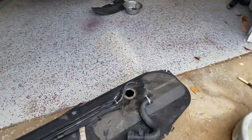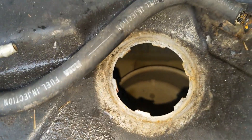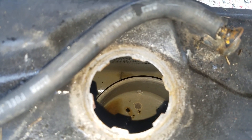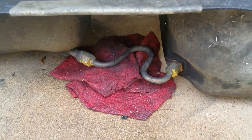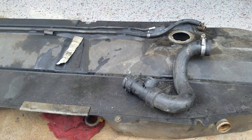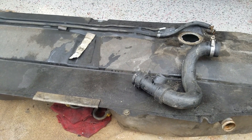The primary reason you're going to get fuel starvation with the older model tank is just dirt down in your tank. Pull your fuel pump and look for a bunch of rust. If you see rust, pull the fuel pump out, take a look at the bottom of the filter, and you'll probably see that it's clogged — and then this crossover pipe right here can also clog. If everything is clean and your fuel pumps are in good shape, you should not get fuel cut-off coming out of any turns until you've been on track for at least an hour and a half or so.